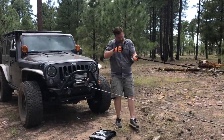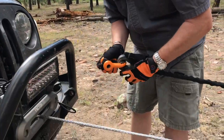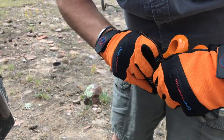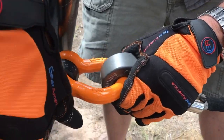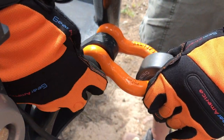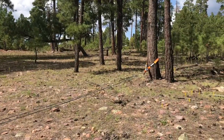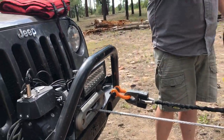We're going to run this back — still on free spool — and hook it back up to the Jeep. Got another shackle here. We're going to take off the isolator because that's just a failure point when it's metal to metal. Hook it right back up to an anchor point on the bumper. We've got the winch re-engaged, the winch going through the snatch block attached to the shackle and tree saver, back to the winch hook and shackle at a fixed point on the Jeep. This snatch block pull is going to effectively double the strength of the winch to pull you out of a really sticky situation.